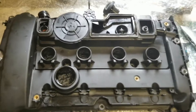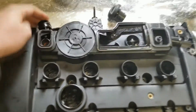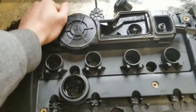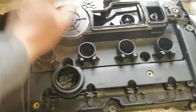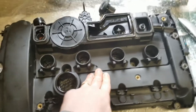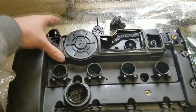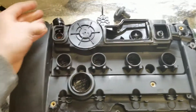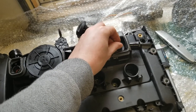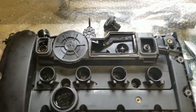The reason I mentioned how it all works is because I've seen people who want to avoid carbon buildup on their valves, so they actually block off this port and the other end on the intake manifold. I've read people saying that's not a good idea because you need that negative pressure underneath the valve cover on the cams. But actually you will still get a negative pressure there — it just won't be quite as strong at lower RPMs. When this side is blocked off, this will always be the lower pressure side and will open up. The downside is that at lower RPMs, the air has to go through the turbo and intercooler, which is going to condense any hot oil into a puddle at the bottom of the intercooler — not great.